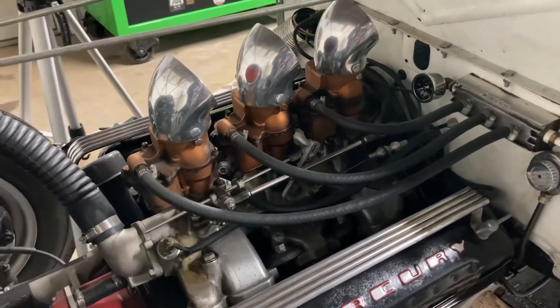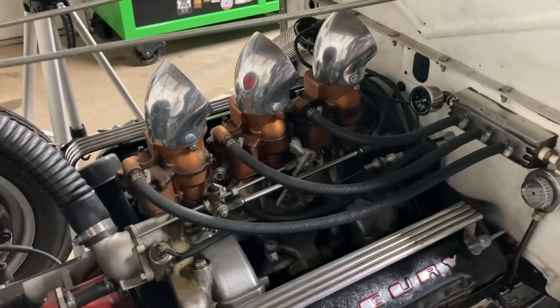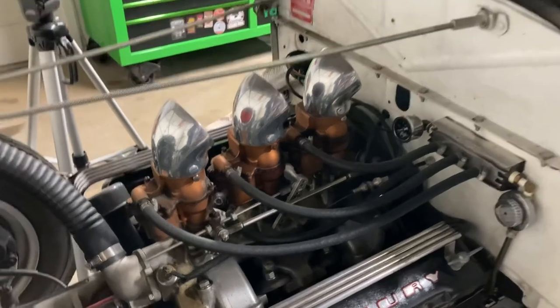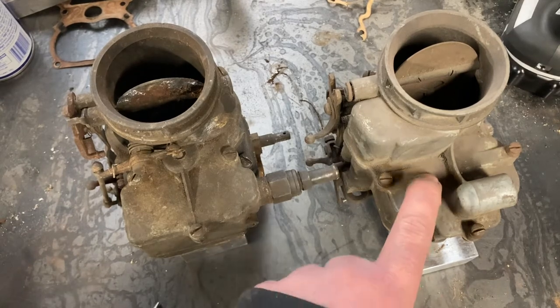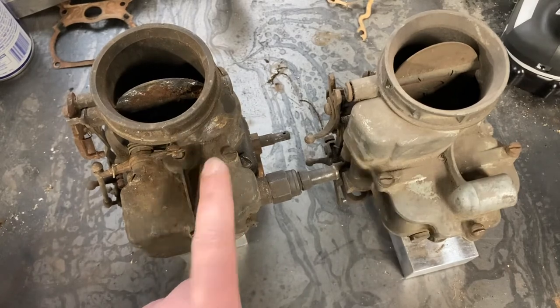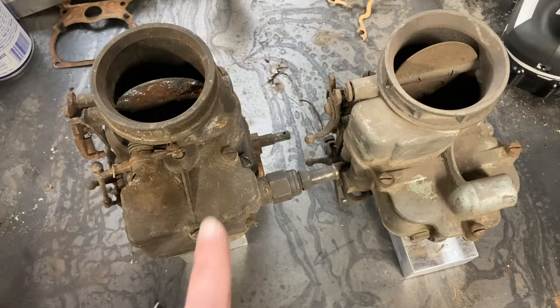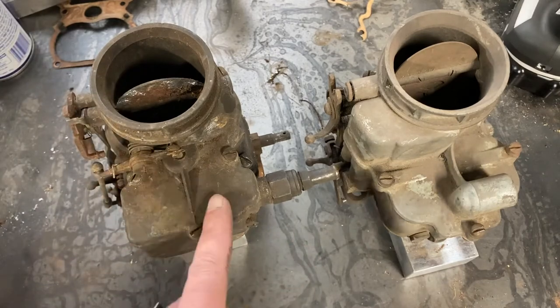But if this situation was in a big car — a '48 Ford or something similar — you may run into issues where you're going to need three properly tuned power valves in all three carburetors. One thing you have to think about when rebuilding these carburetors is the availability of parts. Parts are way more common to come by with the Holley 94 than the Stromberg 97, because Holley's been using the same parts for years and you can find them at your local auto store or local speed shop. With Stromberg, you have to go to more specific stores, mostly online, to get the right parts.